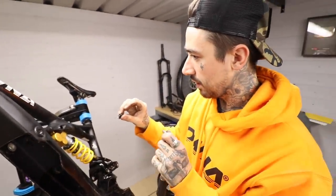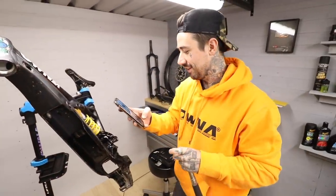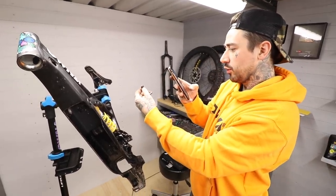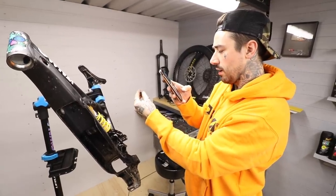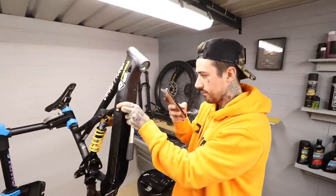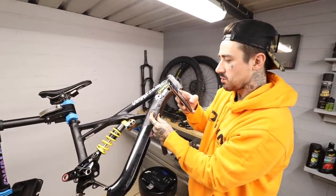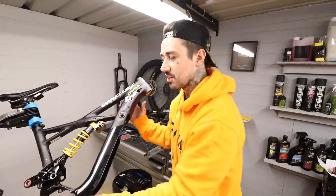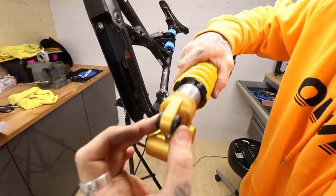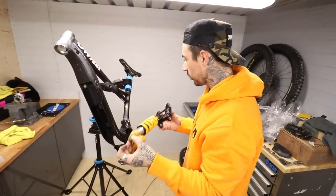The 8mm is on the left side of the bike. I'm going to film a video to my future self — this is a big project. Mr. Main, on your front shock linkage you have a shorter bolt on the left side. It goes on the left side, and on the right side you've got your flush bolt, which is your long one that goes all the way through. See you next weekend, future self. Little washers on either side of that.